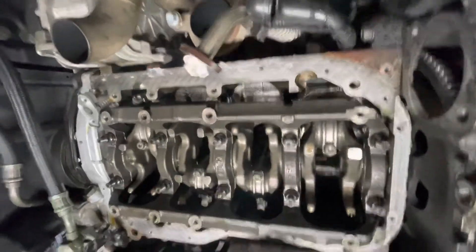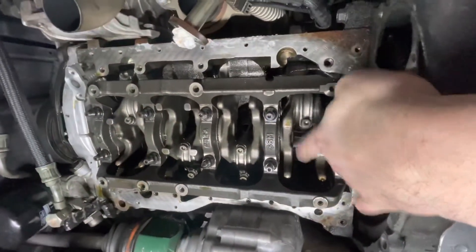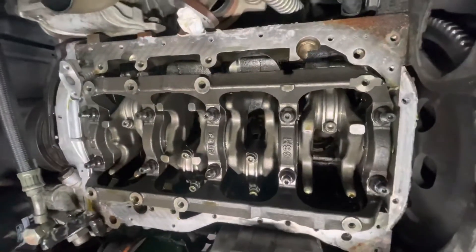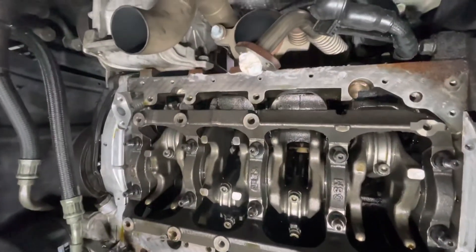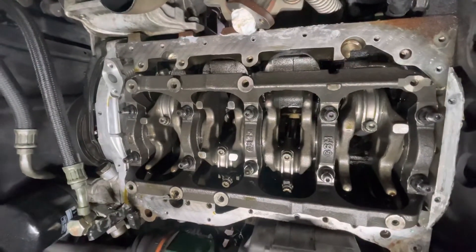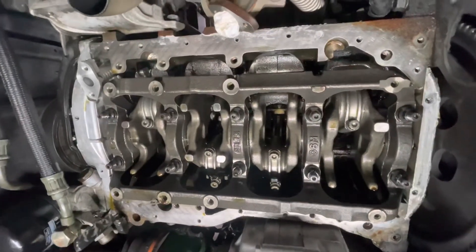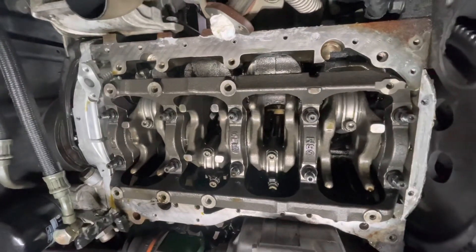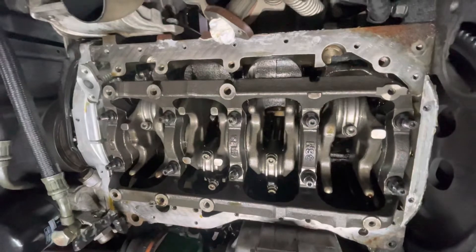Now that we know we have to pull this thing out eventually, I'm going to rotate the crank and take off the rod bolts and the caps and see how the crank is. More than likely I think we'll end up replacing the whole rotating assembly, maybe pick up a spare block just so I have a spare here and then go from there. It's going to be a long process, but that's alright — it's going to be a learning curve and I'll get to learn more about the car than I ever did.